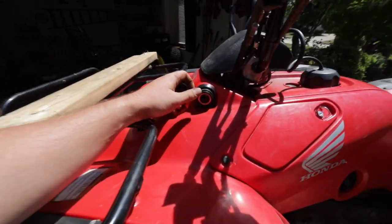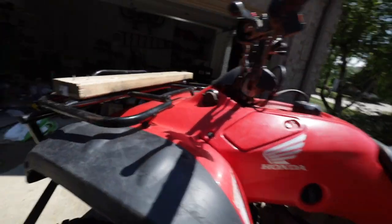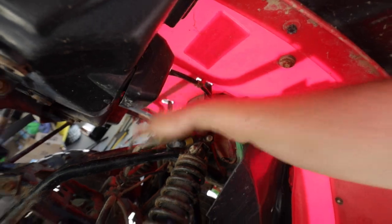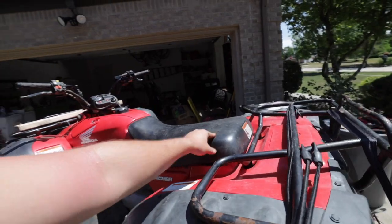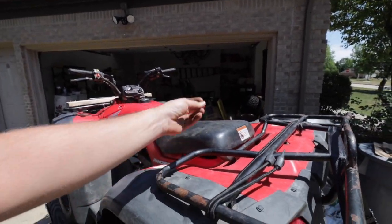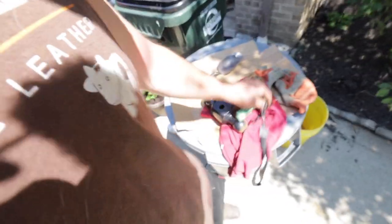What I found out was that the only accessory on this ATV that would ever be drawing power is the 12-volt outlet. On this 350 Rancher there's a 12-volt outlet, and I just assumed that was the thing drawing charge. So I went underneath, straight up unplugged it — and so far it's literally charging, it's running, it hasn't stopped, it's holding like 11 volts. I pull-started it from dead and it's been going ever since. So I'm going to hook it up to my truck — one, so I can take it back, and two, so I can take it for a spin to make sure it charges and runs the whole time.